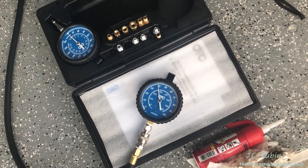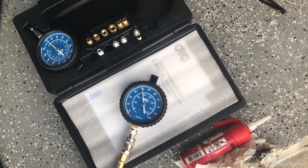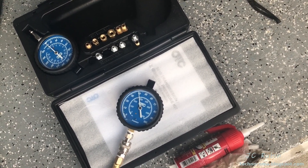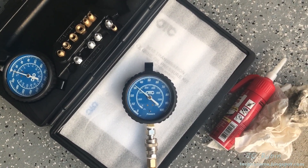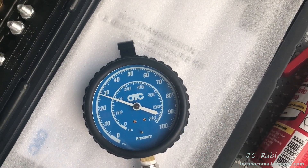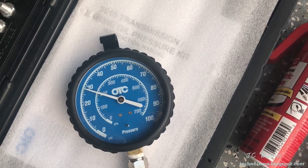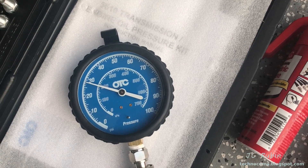Interesting — the incredible amount of time it takes this oil to come up to temp at idle. It's about seven liters of oil and the car still hasn't come to temperature. Granted it's the middle of winter in Florida, but we're still waiting for the fans to cycle. The fans just came on with idle pressure showing just over 30 on the scale. At full temperature idling, it's showing around 26 to 27 PSI. I've got about three fan cycles — we're going to call it 26 to 27 pounds.